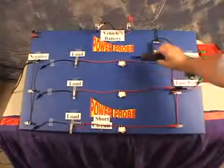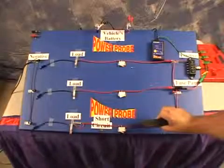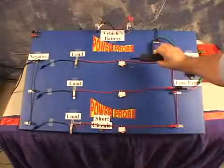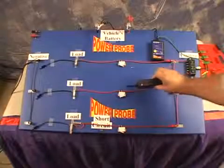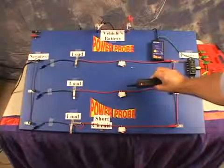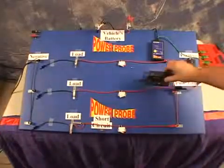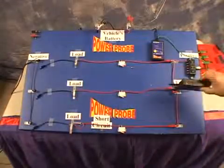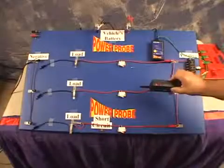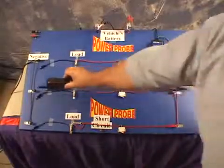Now that our circuit is isolated, we no longer have misleading signals from the other circuits. We can now concentrate on our problem circuit. Follow the open circuit signal until you lose the signal. We're going to close this switch now. Now continue to trace the open circuit signal to find out why it's still open.